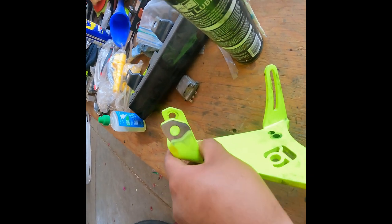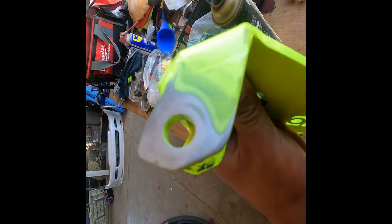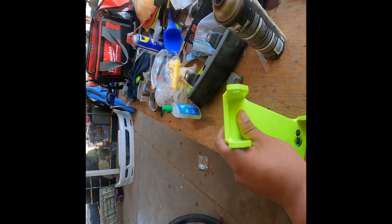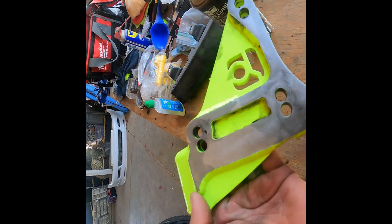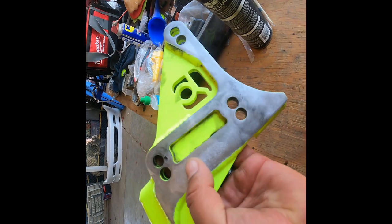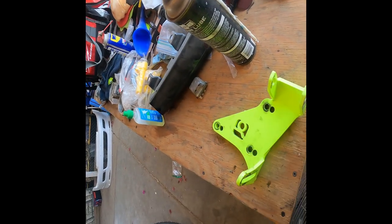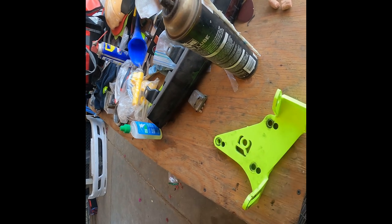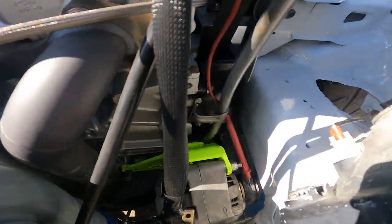This right here is what I'm talking about — I had to sand down this piece and this piece because the bolt goes through and makes contact with the alternator. I also had to shave the rear of the bracket since that makes contact with the engine block. Let me go ahead and install this and let's hope that this is the problem.